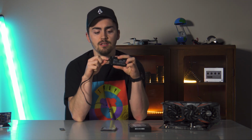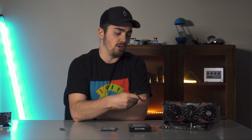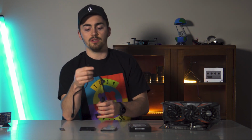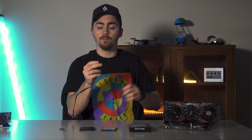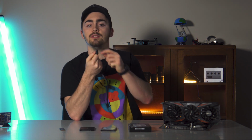Your normal SSD, your 2.5 and your 3.5 drives all plug in with a cable called SATA. SATA cables can be distinguished by the internal L-shaped connection, as they only have one way to be plugged in, and you can't plug them in the other way. The other end of the SATA cable will usually plug in to the bottom right-hand corner of your motherboard. You can also buy cards that will fit into your PCIe slots, which will add more SATA ports to your motherboard. Your SATA drives will also need to be powered from your power source, and you'll often get cables like this where they have multiple different plugs for multiple different hard drives. These look fairly similar to the SATA drives as they have a little L shape at the bottom, so you can also only plug them in one way.